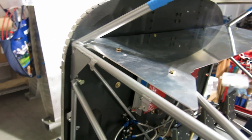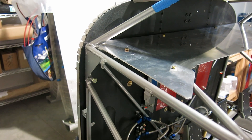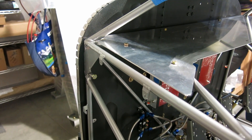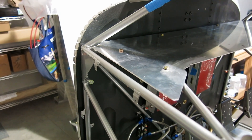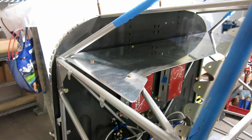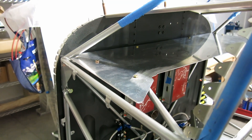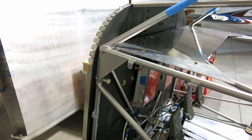We did the pressure sensor manifold fit-up on the front. I need to get fittings for that to go over to the engine, so we're going to figure that out and get the right stuff. Then once we get that done, I can put the fittings on the manifolds, thread seal those, and get it mounted up.